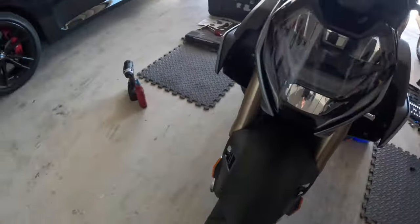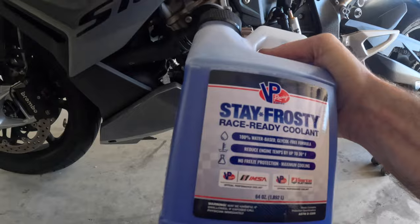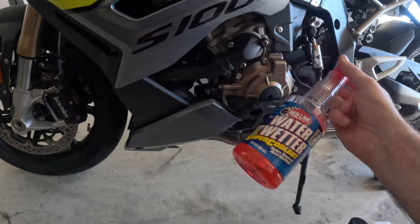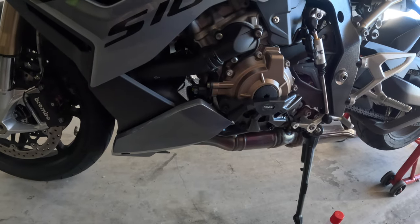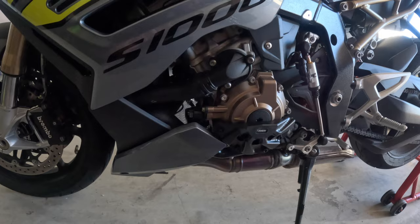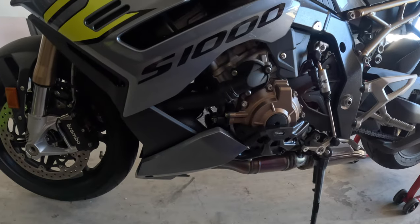To prevent that, I already have the radiator protector, but I'm also going to use a water-based coolant. You can make these yourself — get some distilled water with the right mix and run that. If you're concerned about the water pump or lubricity, you can flush it out and put regular coolant back in. I've run this for 15,000 miles on the BMW with no issues.